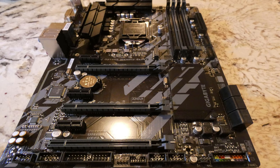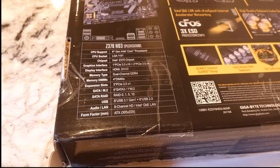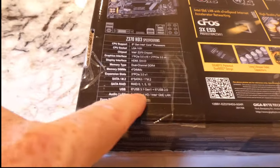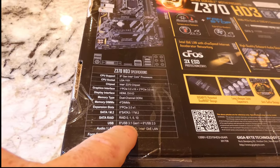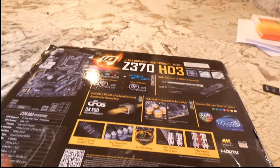For graphics interfaces, we've got PCIe 3.0 x16 and two PCIe 3.0 x4 slots. This is great for not only having one card but also a secondary card. I sometimes use a secondary card inside a computer to record with OBS. Having the bigger slot is also good for expansion cards, as some don't fit in the PCIe 3.0 x1 slots.